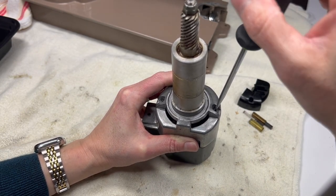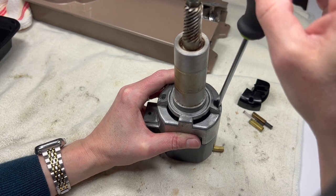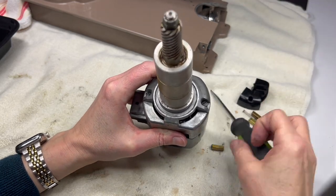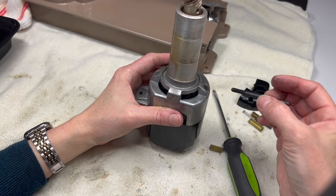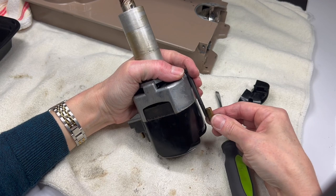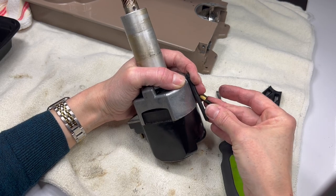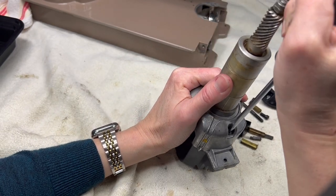Thankfully for Amazon - that's where my parts are coming from - I ordered them today and they'll be here tomorrow. There it came out. This screw isn't fully unscrewed yet so I'll give it a few more turns. It's loose - I just turn it and it pops out. This long screw goes all the way down inside and meets up with the long brass nut, partially screwed into the nut on one end and the motor brush cover screw going in the other end.